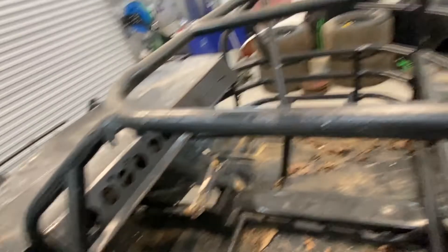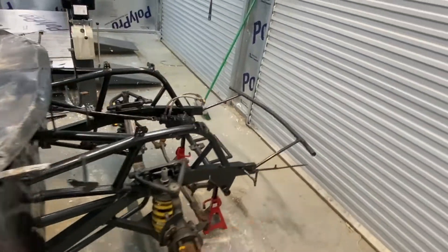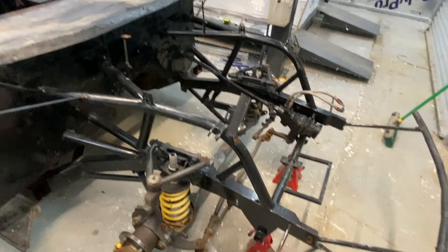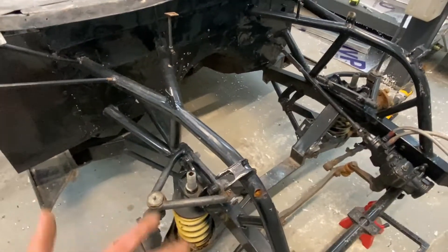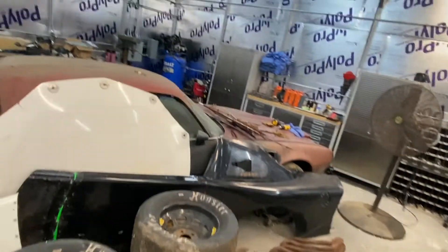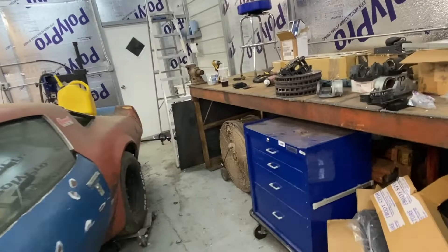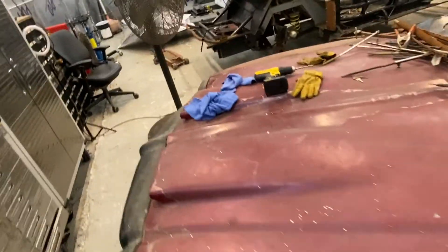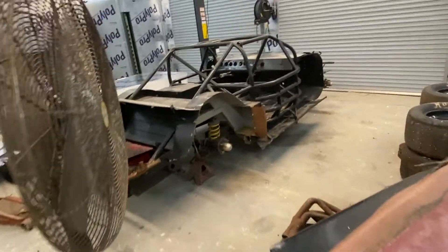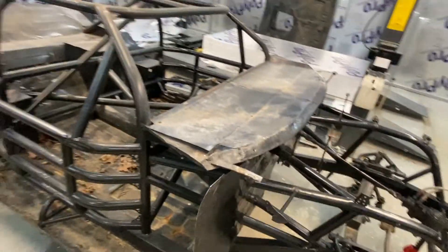So that's off. Next I'm going to cut off what I know has to come off: this rear bar, that cage bit, this front bash bar, and all these little brackets. It's got a regular GM steering box, which is good and easy. I've got more than enough room to put a motor in there. I'm gonna end up putting the 400 out of the '78, and it has a 350 automatic in it currently, but I'm going to run a TKO 5-speed. Hopefully that'll put the rubber to it.